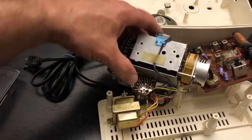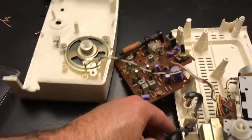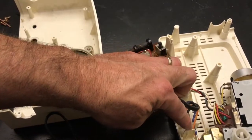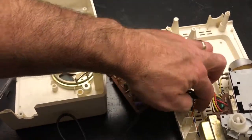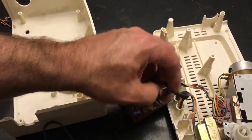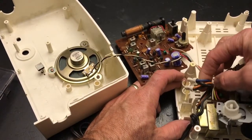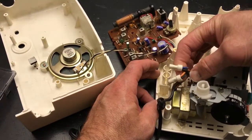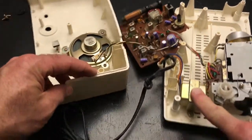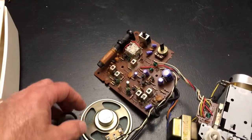There's your transformer - that has to come off. It's just a matter of taking two screws out. Usually where those lines go in is broken, but this clock's intact, which is pretty surprising - those are real fragile. On some clocks, thankfully not this one, it's glued in with a horrid black glue and you have to carefully pry it out. We need to take the speaker and transformer off to get to the cabinet so we can clean it well.